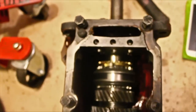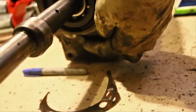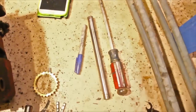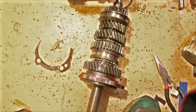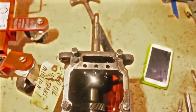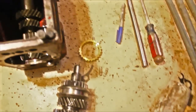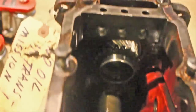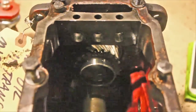Next thing is to drive out the counter shaft spindle — that would be that one right there. Before you do that, rotate this so that it's clear down there, but mark it. When you remove that counter shaft from the bottom, which is this piece, you're going to be able to remove the main shaft, which separates into two halves. You can still see the front half attached there, and this is the rear half. There's the synchro in the middle, a couple of the synchro place keepers, and one roller from the bearing. We've got to be careful not to get any more rollers — already a couple of them fell down, but we don't want to misplace any of them.